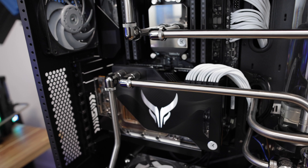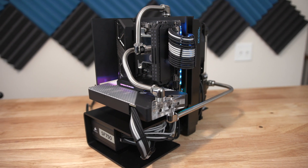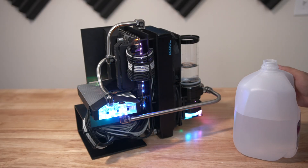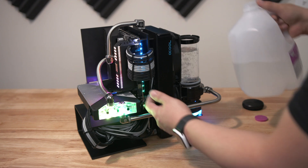But then again, I've always been using full cover water blocks. This is one of my first times in recent years that I've gone with a Plexi version on both the 6900 XT and the 3090. I tend to go with full cover water blocks — either the acetal version or some kind of full covering — because I run distilled water and biocide. I don't really like changing out water all that often, maybe once every half a year or so. And the maintenance with something like pastel, the nanoparticles fall out or the staining from colors — I just don't want to deal with that. So that's why I've always been gravitating towards full cover blocks, distilled water, and stainless steel, glass, PETG, or acrylic tubing.